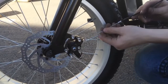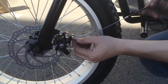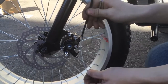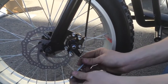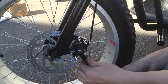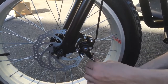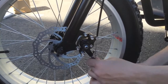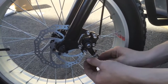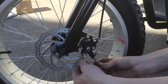Slide your cable all the way up and slide it through this hole right here, making sure it only goes in with the side with the hole. The cable sits down in it. You'll loosen this bolt, and on the right side of the bolt, you'll slide the cable through. Make sure to pull on it and tighten it down.